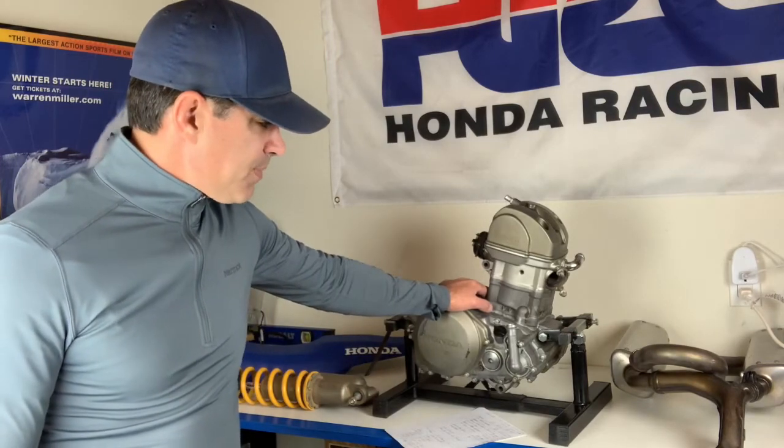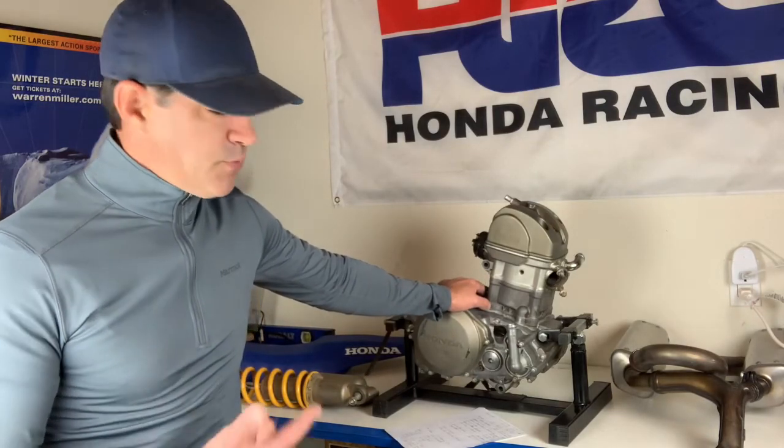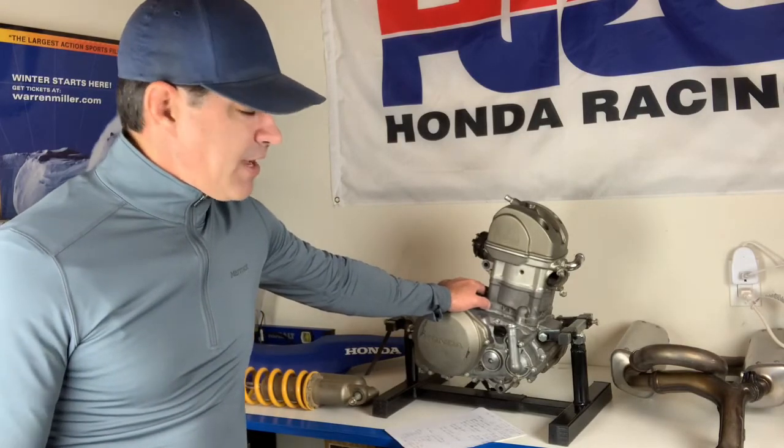I know that there's a lot of challenges with the 450. Now, the 250 project that I did, I was able to convert that over to a dual exhaust, but I was talking to a guy from Encinitas in San Diego just this last week. Lives not too far from the beach. I picked some parts up from him, and he was telling me that it's quite a challenge to get these older 450s to run with a dual exhaust, because there's a lot of back pressure and issues that you can run into there. So we'll give it a shot and see. I've got both the single and the dual, so we'll see what we come up with.